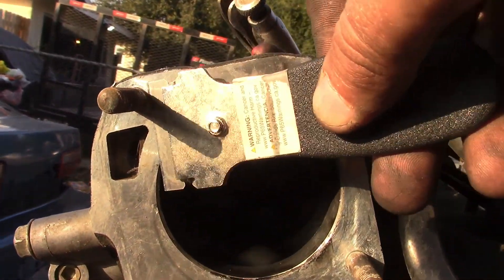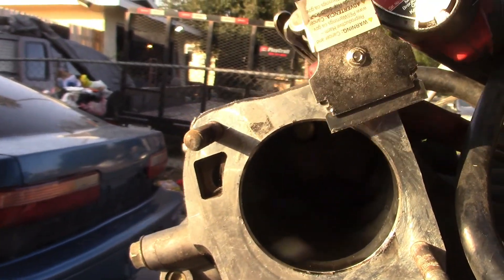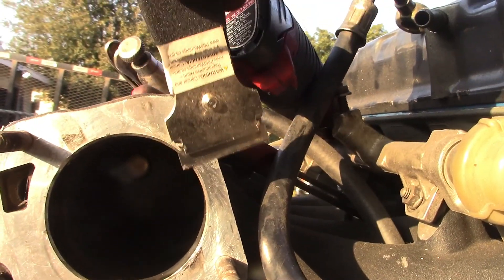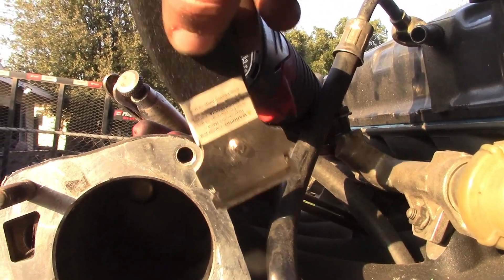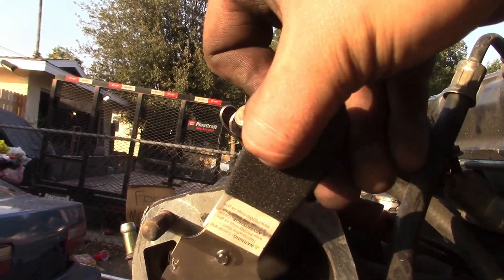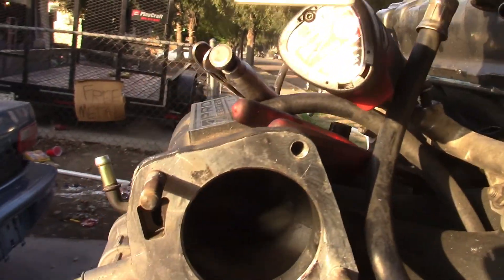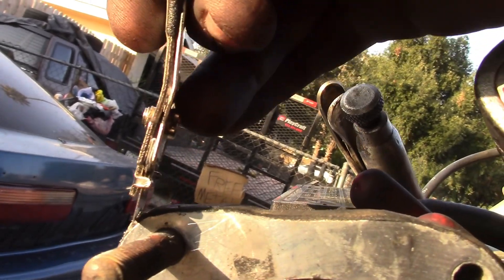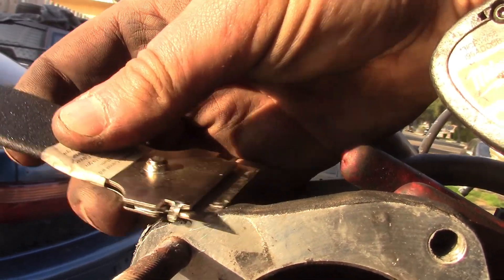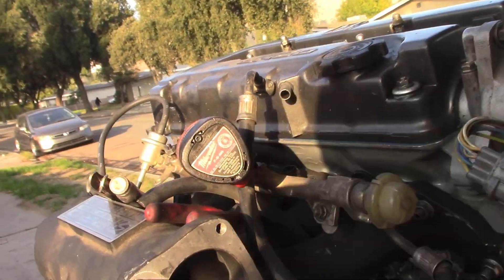Due to the fact that when it seals, you don't want it to be impacted by the silicone - you don't want a gap, you don't want it to sit sideways or anything, you want it flat. So anything that looks like silicone, just give it a light scratch. You can get these at AutoZone - just give it a light little scratch, don't gouge it. See how it's coming off? The intake manifold comes off easy. No silicone - silicone bad.